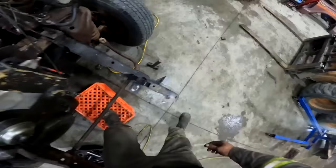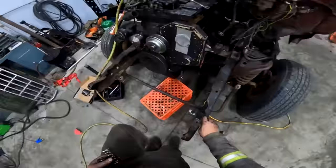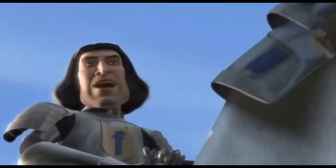So go ahead and grab yourself a couple new valve springs. These are 60-pound valve springs set up for the 4K governor spring. What that means is you have 4,000 RPM to the crank in this dirty old 12 valve. If you're worried about the differences in the two, you can definitely tell. This one is me, this one's sawed off Frenchman. I am sawed off Frenchman.